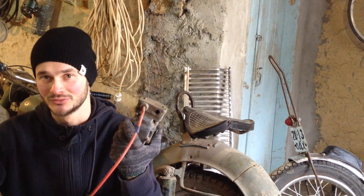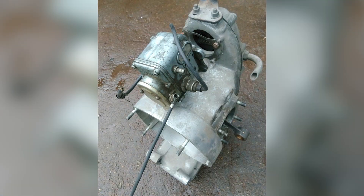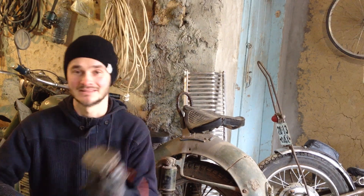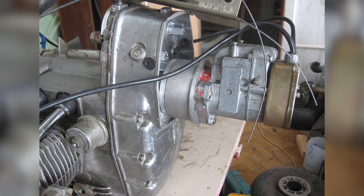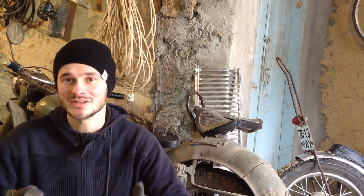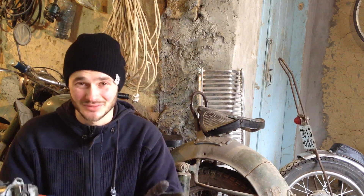One option is to install a two-wire tractor starter engine magneto just like this one. We don't even consider the magneto from Ural-Cross because it's very difficult to find, and even if you find it, it needs to be installed in place of the generator, which means we're left without charging. The tractor magneto needs to be installed in front of the camshaft, after which it sticks out about 8 inches forward. I've also heard stories of guys who install a magneto using two gears — one gear on a camshaft, the other on a magneto, connected with a chain, and in the end it all sticks out appendix-like on a right or left side of the bike.